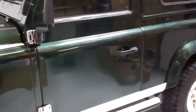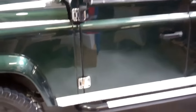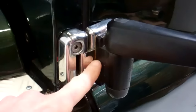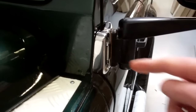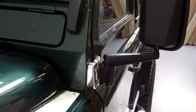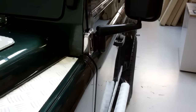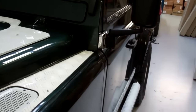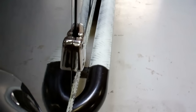If this is a two-door Defender, the rear hinges on a four-door are the same as the front — the only difference is the top hinge has the holes mounted differently. The hinges are on a slight angle because you need a common axis running through where the bodywork steps out. The bulkhead is inset and then goes out, so you need a line drawn through the two hinges — a bit of a slope. When fitting the hinges you should always see this slope going from the top down to the bottom one.